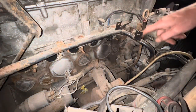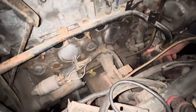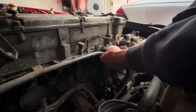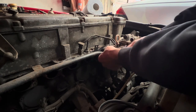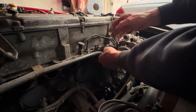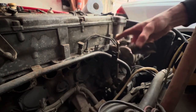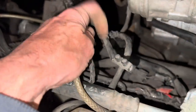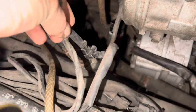While we're here we might as well rip off this coolant pipe here and also this Y-shaped pipe down here — send them off to the powder coaters and get them looking like new. When you take this bracket off just remember that the pipe bracket goes closest to the manifold, and the bracket that holds the oil dipstick on is on the outside. Before you take these pipes off just make a note of anything cable-tied to the bracket so you can remember to put it back where it came from.